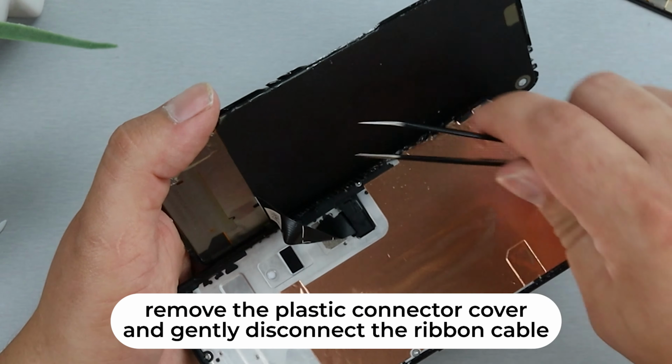All right, I fixed my mistake, but some of the adhesive under the OLED and around the frame's edge has gotten twisted up in the process. This could pose a problem with the screen laying flat, so I'll go ahead and remove the new screen and replace the mangled adhesive. It's really important to not skip steps when you're working with a screen that's glued down like this. These screens can cause major headaches if you don't do it right the first time.